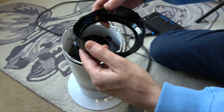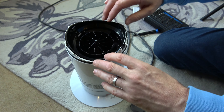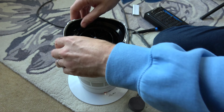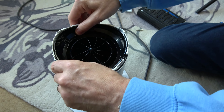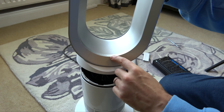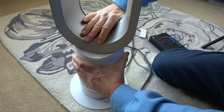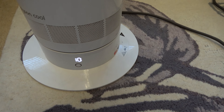It's important that after doing this you make sure the fan is still spinning freely, because if it's not you're going to have a problem. Next up, put this outer section on — you can see there's a little cutout here that's different from the rest, and that again is to go where the wires are, so you can't get it in the wrong position. Do up the four T9 long screws.